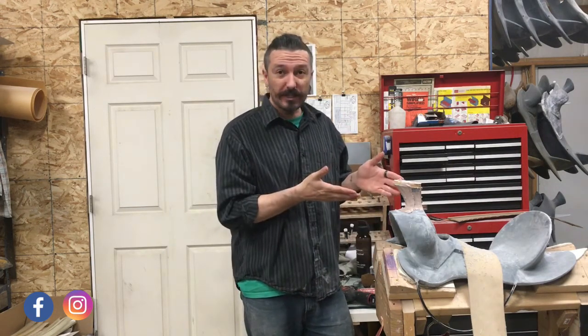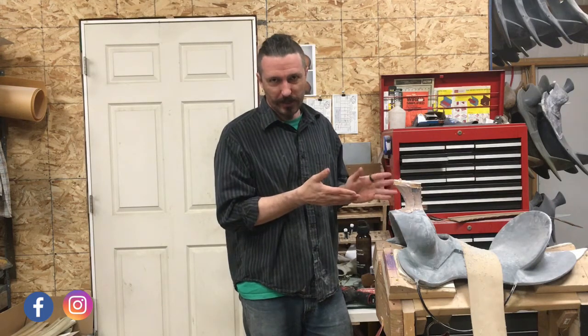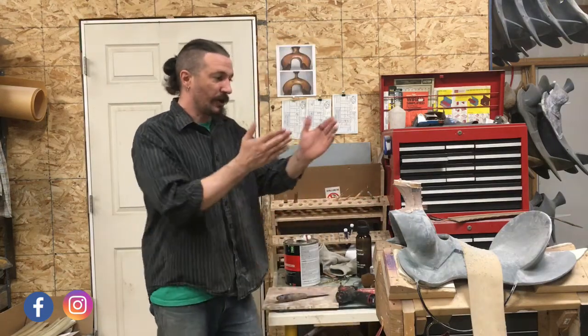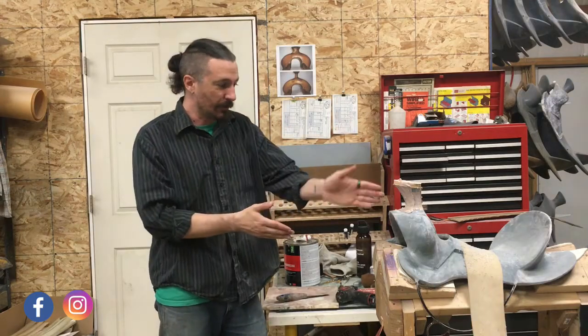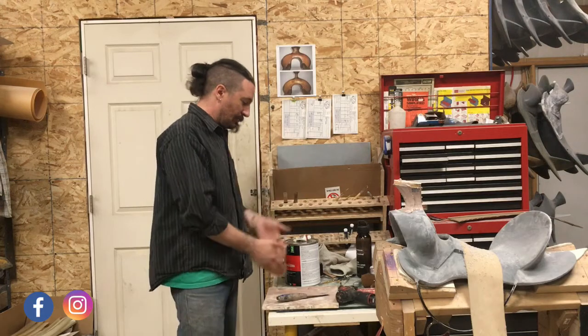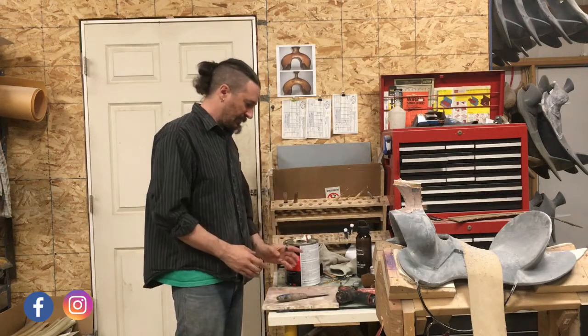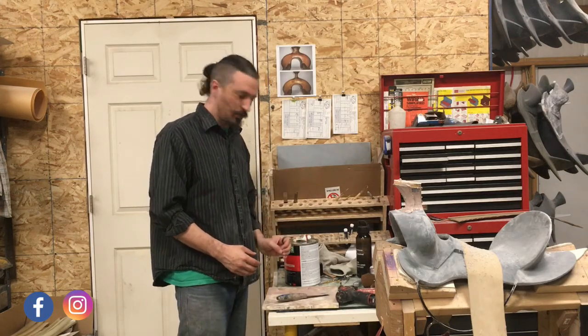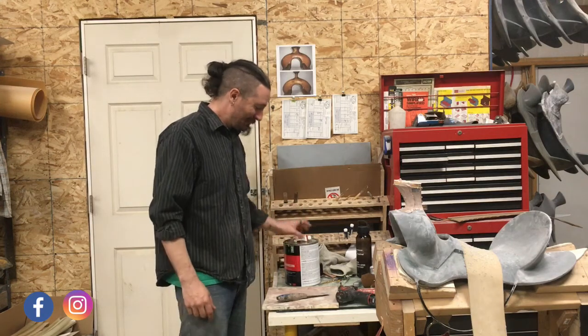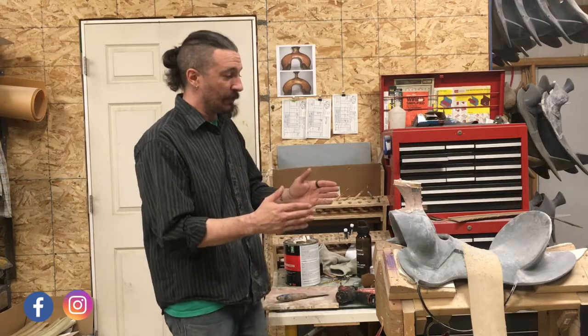Okay, so that was relatively easy. I've done this several times, so I was able to do it fairly quickly. Let's just talk about it a little bit while this guy sets up. You saw I put the piece in. I've already had my center mark in. I put the screws in, and then mixed the Bondo. For this, just a golf ball size would work, and a one inch length of red, the hardener, and mix that up.